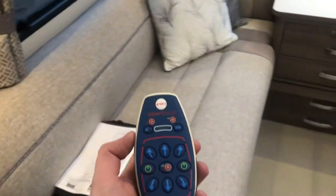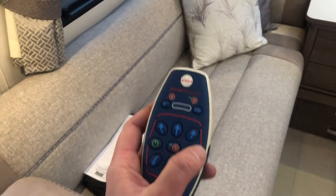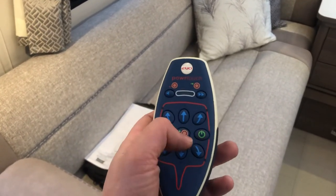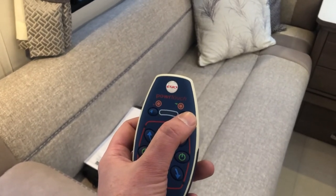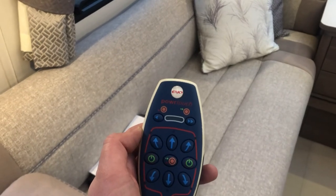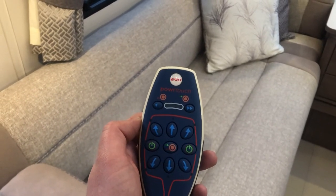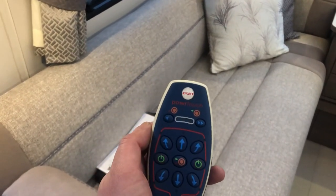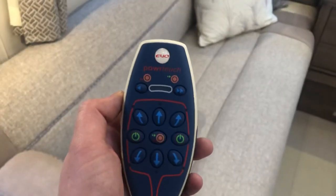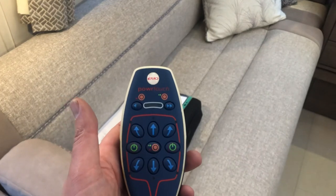Lastly, on the motor mover — when you've turned on the isolation key in the battery box, you'll see there are two on-off buttons. You need to press both together to put it on, but only one to switch it off. When you put it on, let it flash and sync up. Once synced, press one button to engage the mover onto the tyres and the opposite button to release it. That electronically engages the mover onto your tyres — visually check they're on, then release the handbrake and use the motor mover as you desire. When finished, put the handbrake on, release the mover from the wheels, press one button to turn it off, then turn the isolation key off in the locker.